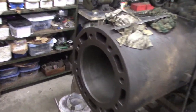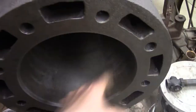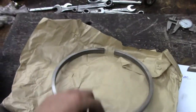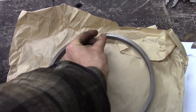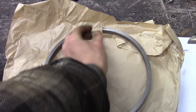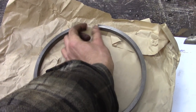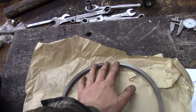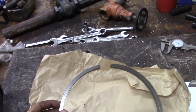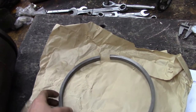The first thing to do is to install the piston. I took the piston out and cleaned up the bore, and what I'm doing is making sure these rings — these are new rings — are properly gapped. Because if the ring end gap is too close, when the engine heats up while it's running, the ring ends will actually expand, the whole ring will expand, and the ends will come close and bind up. So you want to make sure there is enough clearance. The rule of thumb is four thousandths per inch of bore. So for a nine inch bore, that's thirty-six thousandths.